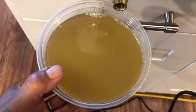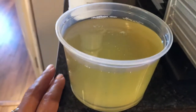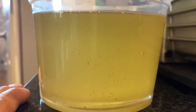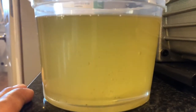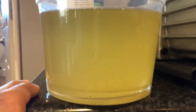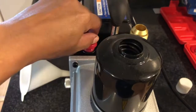There you have it — it's done draining. I just want to show you how much oil it actually takes; it takes about that much oil to fill the pump. As you can see there are particles in it, obviously from the freeze drying. If you're doing really long freeze dries, I normally clean it every three freeze dries, especially if it's like 38 hours, but it's normally every three or four anyway. It's very cloudy as you can see, so yep, it was time to change it.